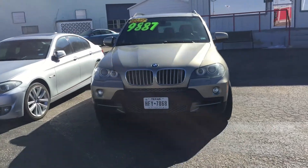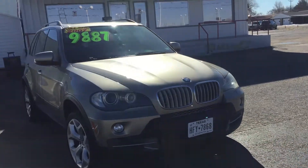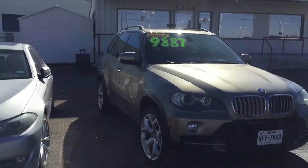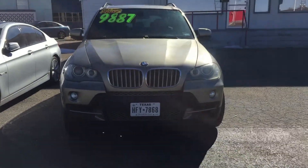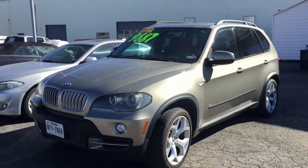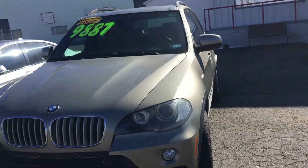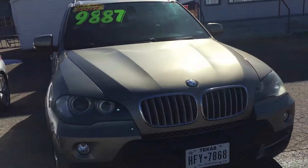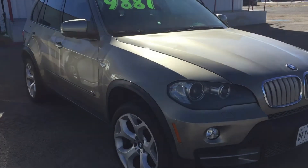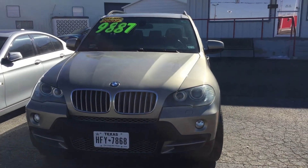Hello YouTubers, today we are going to be working on this 2007 BMW X5 4.8 — beautiful vehicle. It just came in and it's already sold. But we're having issues with the thermostat; it's popping up a code of P0128, which usually means it's the thermostat. The fan's been picking up on high, and we've also noticed it's been leaking from the thermostat, so that's why we're going for the thermostat.